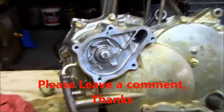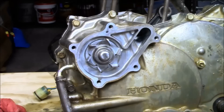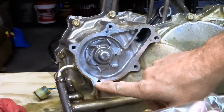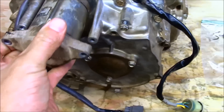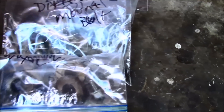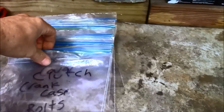Next we're going to do the water pump. The only thing with the water pump is make sure you replace the O-ring inside the cover. In our bag of bolts there are five bolts, and only one bolt has a copper washer — that copper washer goes on the bottom. Make sure you replace that; it'll come in your gasket kit. We're going to install the starter. We'll put a new O-ring that came in the O-ring kit. The starter only goes on one way — can't mess that up. I want to reiterate this: put everything in Ziploc bags and label everything — motor mounts, differentials, bottom skid plate, the reverse cable, footboard, plastics, clutch case — everything in plastic bags labeled and kept in order, so as you reassemble, the bags are in order also.